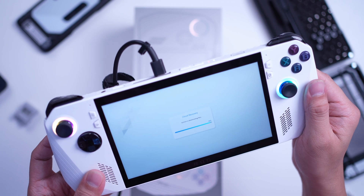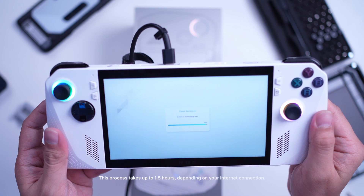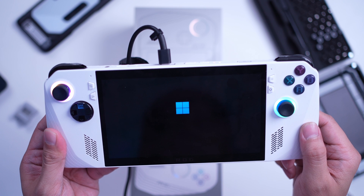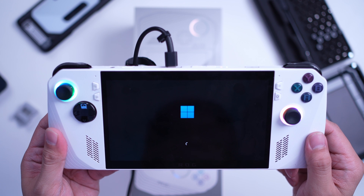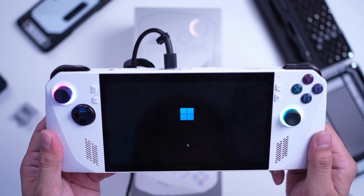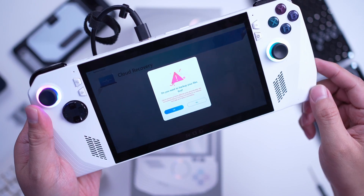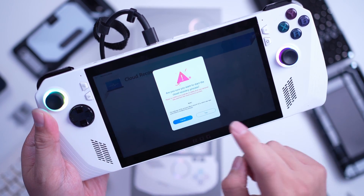Be sure that you have more than enough battery to proceed through this process. It is also best to connect the Ally to the outlet throughout the Cloud Recovery process. Once it is done, click Confirm and wait for it to restart. This is the point where additional software are downloaded to prime the Ally for quick use after the recovery process. This will take some time, so please be patient. Just go through the process, and once you're asked if you want to back up your files, you can simply ignore this since the premise is you're using a brand-new SSD.